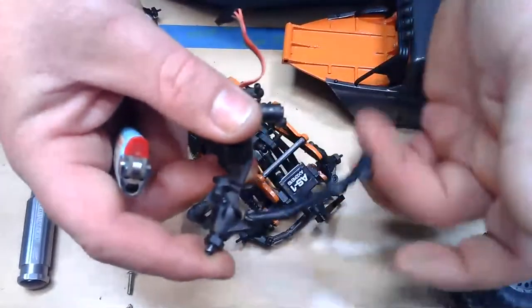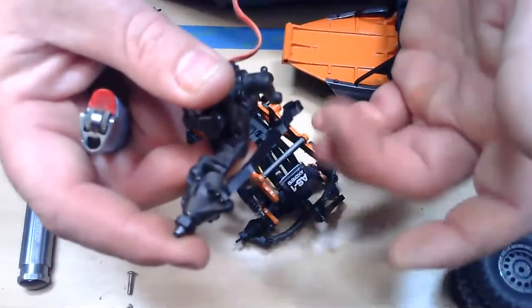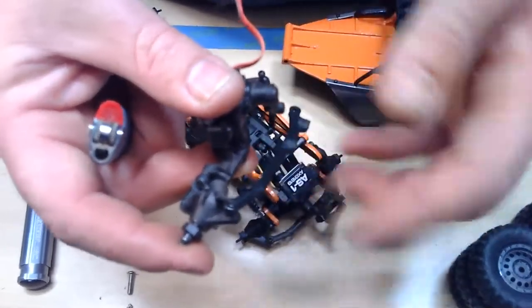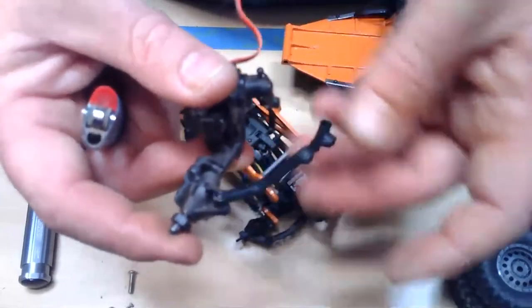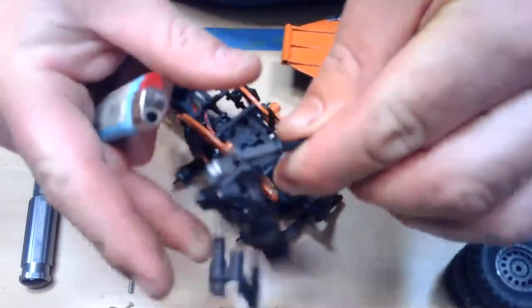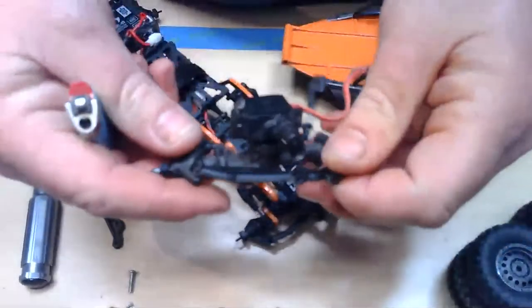Oh yeah, this is real nice and just perfect now. Look at that. Can you see that? That's perfect. You want it to move kind of freely on its own like that. And now when this cools down, it'll harden back up, and it'll maintain that position of easy motion. And it's still not going to pop right off. It's still on there real nice and strong. It's not going to snap off when you turn the steering wheel.